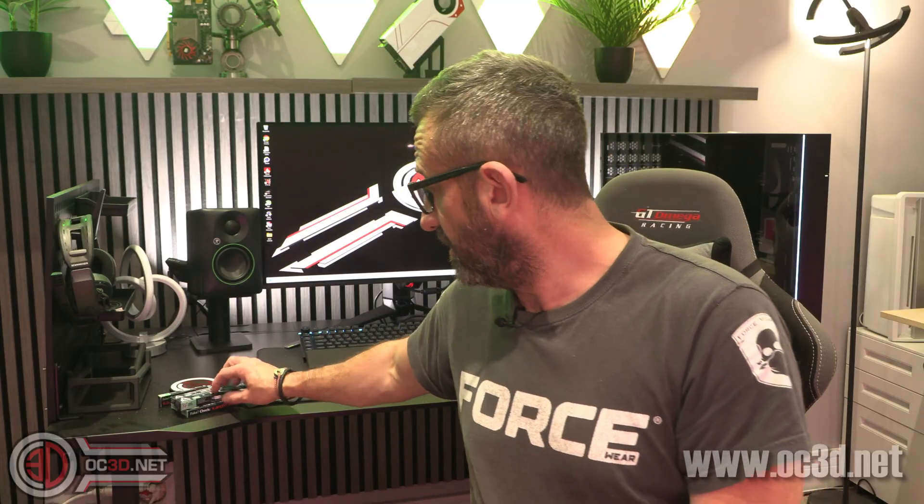Anyway, quick video, quick performance summary: yes, you do get a bonus improvement. It's really not expensive, and if you've been looking at your graphics card or CPU temps recently thinking they're hotter than they used to be — you've hoovered it, cleaned it, and still got high temps — you probably need to change your thermal paste. And considering you can get an eight-gram tube of this for less than ten quid, I think it's a bit of a no-brainer.